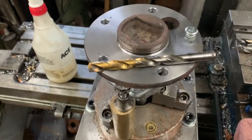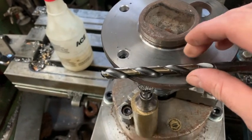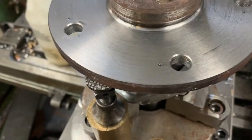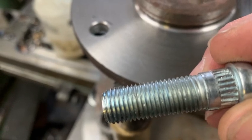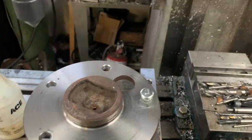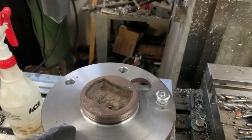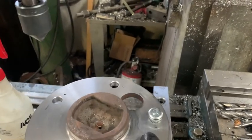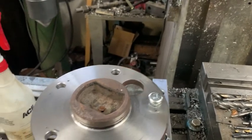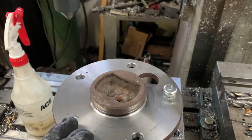Got the five holes drilled in this one. Used a 29/64ths drill — I went with 27/64ths first and then just used 29/64ths to finish opening it up. The stud just fits in nice. You can see the area between the threads and the knurls — that's your guiding part, slips in nice, then we'll just pound it in. Over the years some guys take an impact and ram them in, some hit them from behind — everyone has their preference. At one time we had a jig made for tractor companies that would press them all at the same time from the other side. I'm quite aware the stud is backwards right now — this is just a show, I'm just waiting for someone in the comments to say the stud is backwards.